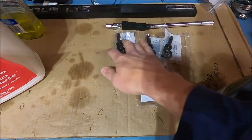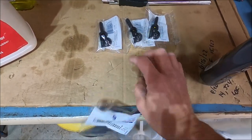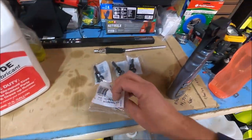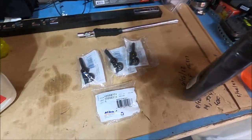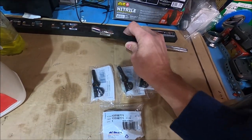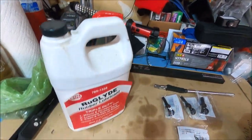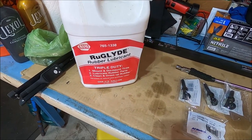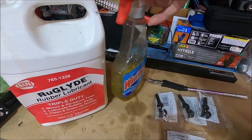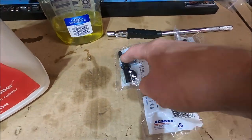So I went ahead and bought four new TPMS sensors. Oh, crap. Just dropped that one on the floor. Here's the part number. And I'm gonna put them on myself. I have a valve stem puller, and I have this lube I've had for a while. I put it in a Windex bottle just to squirt a little around here